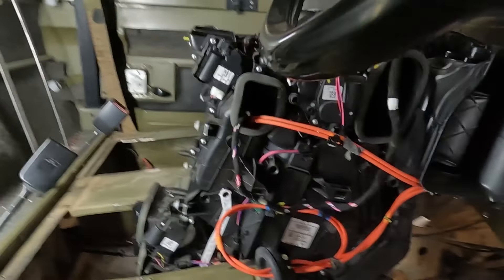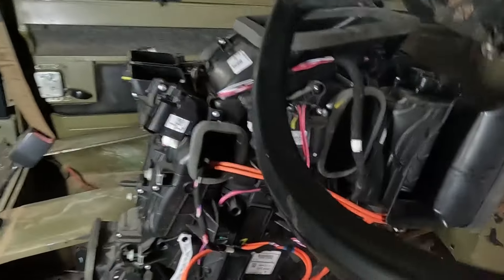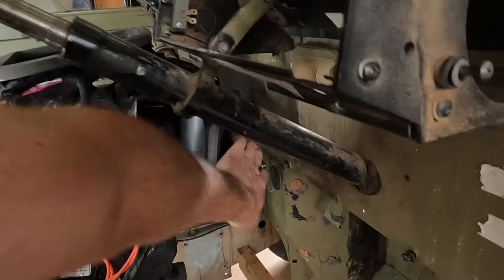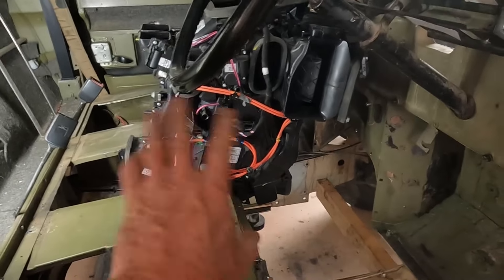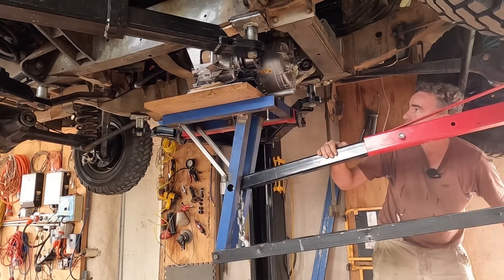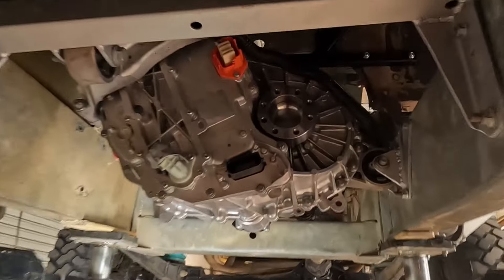You can see why I had to cut that middle bit out - it just makes it sit down more. I need to put the motor up in there just to see the clearances, and I'm actually quite happy with that. The refrigerant lines come to a good spot in the firewall. So I'm going to get the motor mounted in here - so much easier putting this in than even just the transmission of the Land Rover, which was a nightmare. Check it out - motor is in, looks good up in there, very happy with how the mounts turned out.